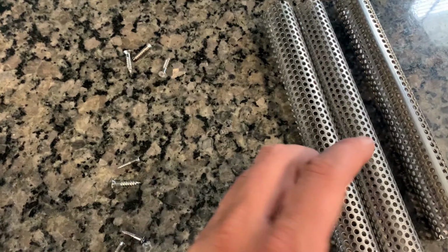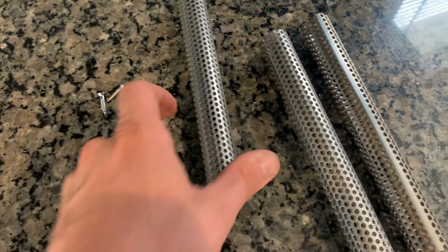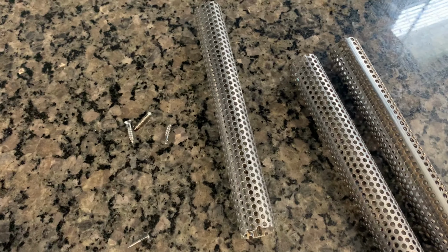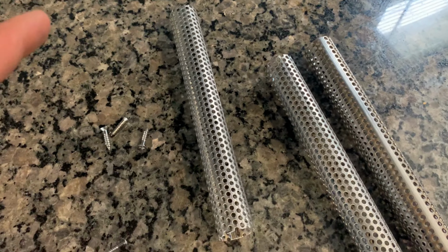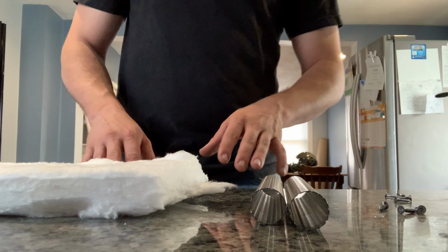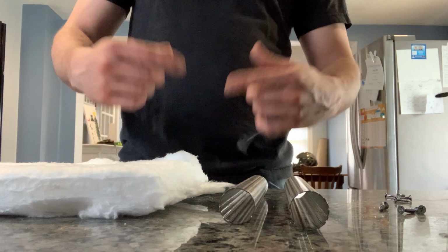But we're going to try to basically pack this exhaust. We're going to slide it down inside, and we're going to run those screws up through one of these holes into the holes on the factory Toce exhaust baffling, and that should fasten everything in place. And we're going to want to wrap these very tight and very thin because we only have a little bit over 1/8 of an inch to work with on these.